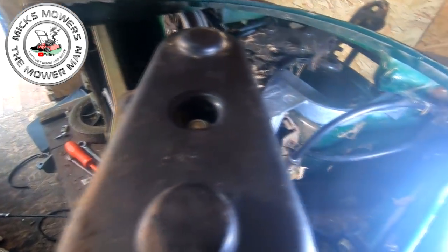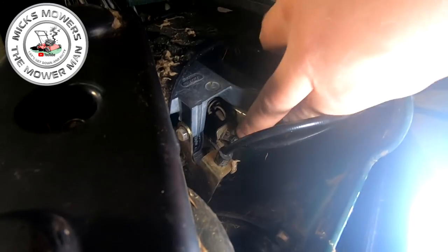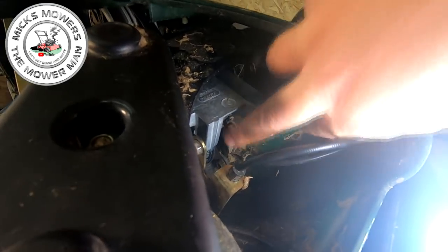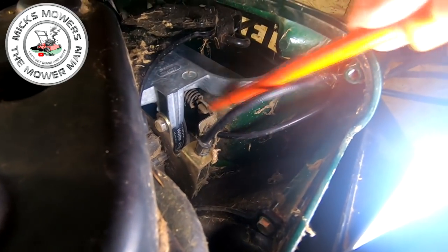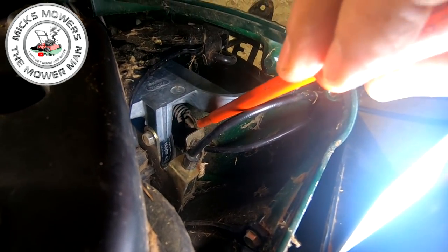Just about there. The spring to your variator goes on there. You see it right at the very, very back here. It's a little tiny niblet where your spring goes. Let me get a pointer. That would be even easier, Mick. Right, so the back of the spring goes on that little tiny hook just there. There's a little tiny niblet for that spring to go on.